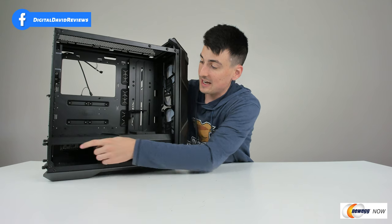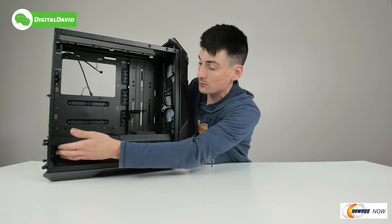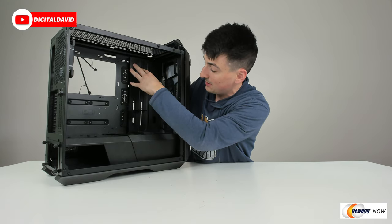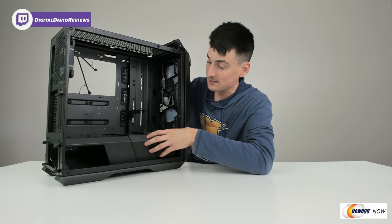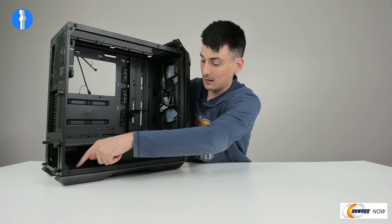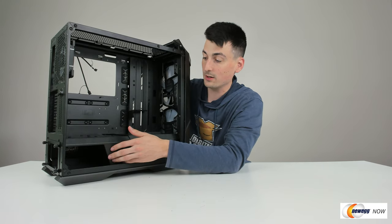Now you may have noticed at this step we actually modified the shroud down here. So we removed the panel so we can expose our power supply. This was quite the process, so I'd highly recommend if you are going to do something like this, that you do this before you get any other parts or components installed, because you'll have to remove three different sections. This section first with most of the screws on the back, then you'll have to remove this shroud that's covering our hard drive base, you'll have to remove the hard drive base as well, and then you'll be able to remove this shroud. I believe there's around 11 screws total. A couple are on the front and a couple are on the sides for that last shroud. But if you do want to expose the power supply, that is something you're able to do with this case, which is what we're going to do in this build.